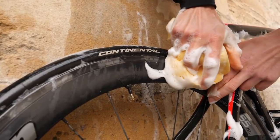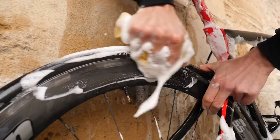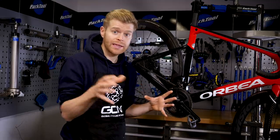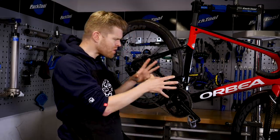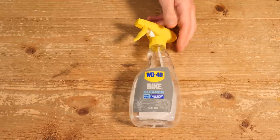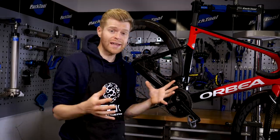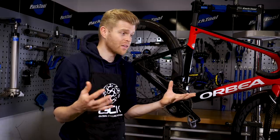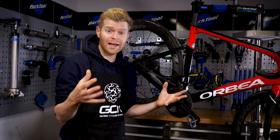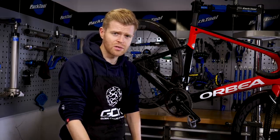On braking surfaces, any dirt or grime that's left on there will also cause accelerated wear. In terms of how to clean your bike, drivetrain, and braking surfaces, we've got lots of videos on that — we'll link to those in the description below. In terms of what you clean it with, bike-specific products are great, but if you want to save some money, petroleum spirit is one of the most cost-effective degreasers you can buy. It's also highly effective, though it's flammable and not too good for the environment. There are also environmentally friendly degreasers available as well.